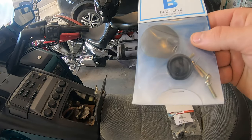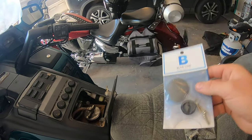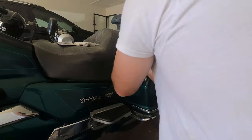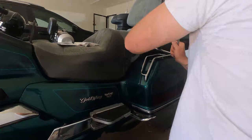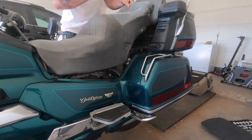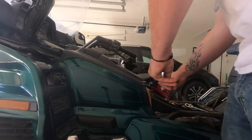This is what I got in my rebuild kit. It has two of the rubber diaphragms, a spring, and screws. Really, the only things I was needing were the rubber diaphragms. My drain pan was wet — that's there to catch fuel that leaks from the petcock and drains down to a safe area so it won't catch fire, because that'd be a fire hazard. Mine was wet and I had a consistent stream of gas running down that drain, so I diagnosed it as a leaky petcock.